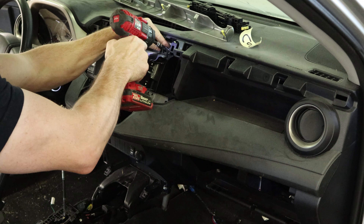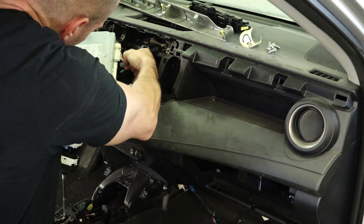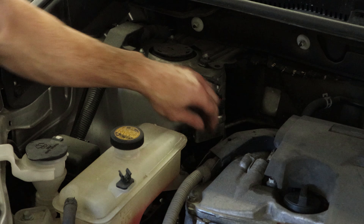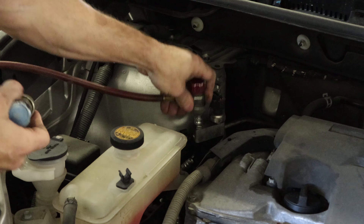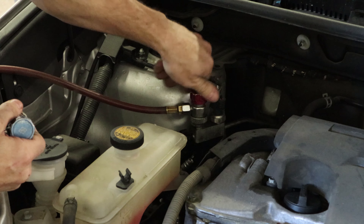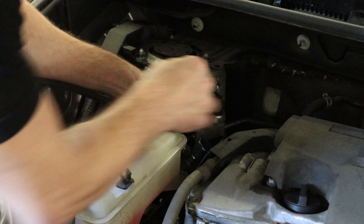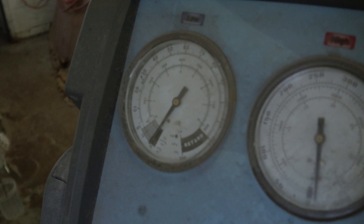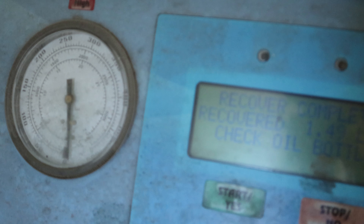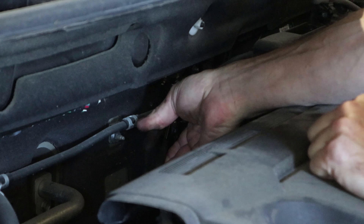The radio out that we just put in. While we're doing that we're going to set up the AC machine to discharge the AC system, as we are going to have to open it up. And we're done. There's only supposed to be 1.24 pounds of Freon on there. It was a little extra — I'd be willing to bet they added more Freon thinking they could make it colder. That's actually because the doors were stuck. Somebody's been here before.